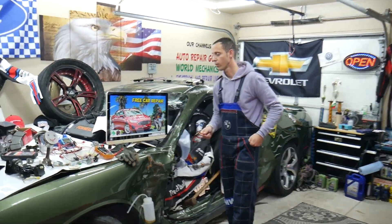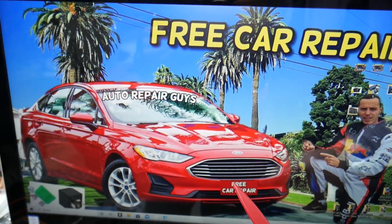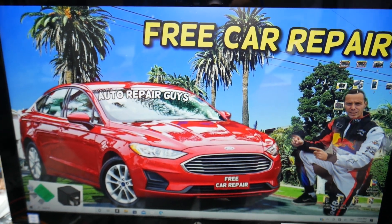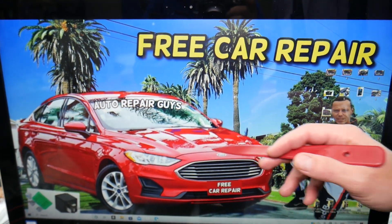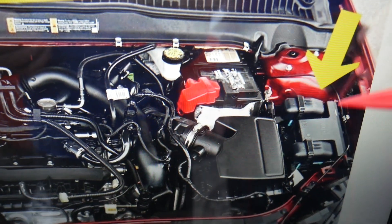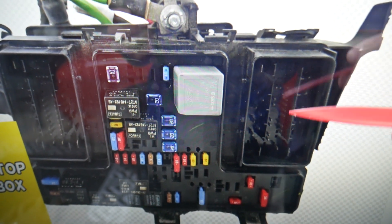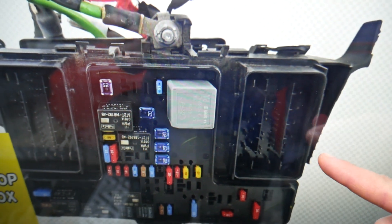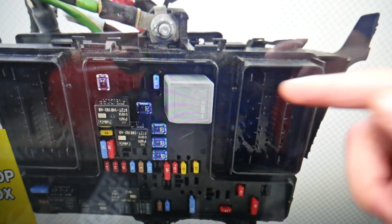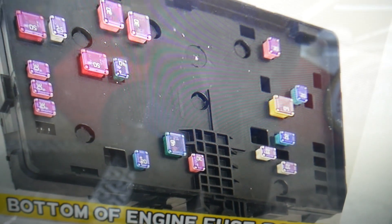So let's start. The heated windshield fuses — where to find them. We'll demonstrate on this generation Ford Fusion. By the way, there are many fuse boxes and some are very hidden. We're working in just one of them today, but check out the video on our YouTube channel about fuse box locations on Ford Fusion. Open the hood. On the right side you'll see a cover that looks like a T. Open it — that's the main engine fuse box. But underneath that one, pull the tabs and it will flip, and on the bottom of that fuse box you'll find the hidden fuses.